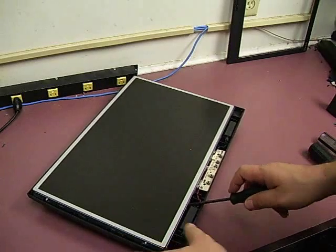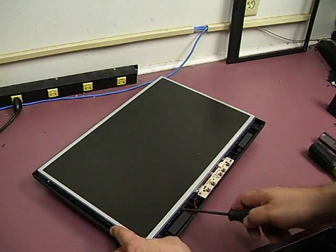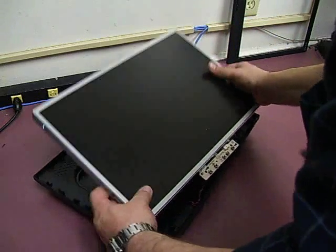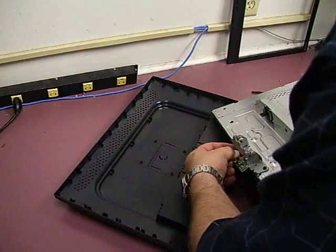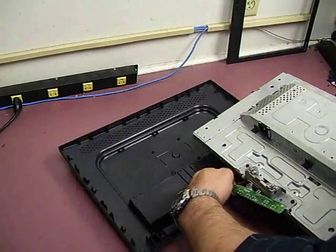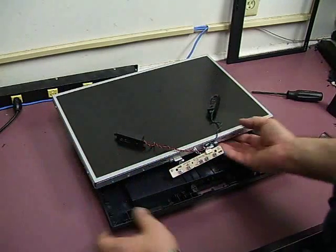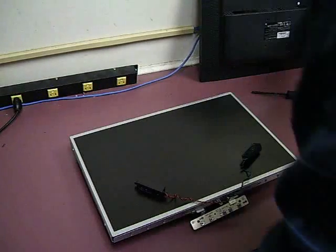There are little clips, and there are also some in the center of the bottom — same kind of thing. Now the monitor starts to lift up a little bit. Now we can turn it over and work your way around. Pull off your two speakers. Now we can remove the back panel, or the back plastics, from the panel and just set that to the side.